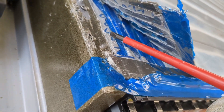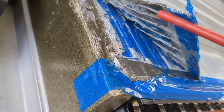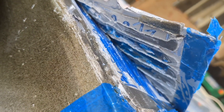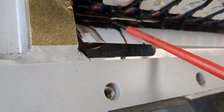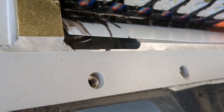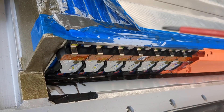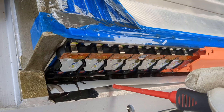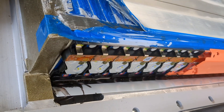This grey goop here is rock hard — well, certainly quite hard — it's like a glue sort of stuff. You can see where it's glued between the channel and there's some sort of thermal epoxy stuff there. Then if we come down in here you can see down the bottom of the cells, into the bottom of the pack, there's like a rubbery resin goop stuff poured in. So the cells are placed in the bottom of the pack and then this stuff is poured in afterwards. There's also this little plastic plate here which I assume is just to protect the aluminium from the cells so there's no accidental shorting during manufacture.